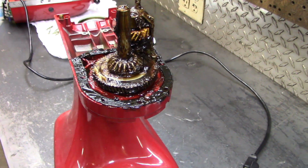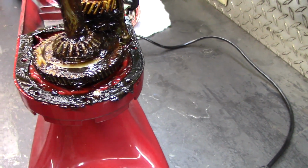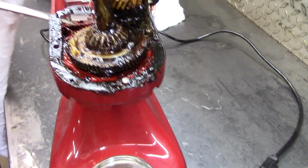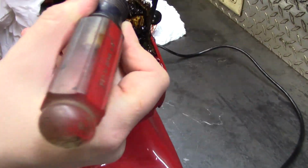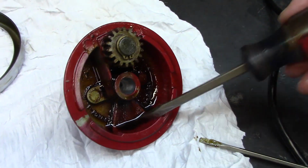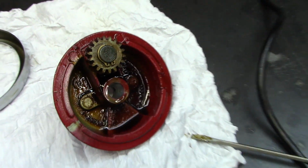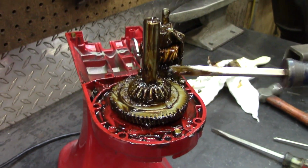So here we are, open, some of the grease cleaned off with the chip brush, and we have this little pin that's holding in the seal. We can lift the seal off very carefully. There's actually tabs in the back, which make that a little easier, so we can clean under it and probably even clean the seal a little. Yuck. This is quite liquid. I mean, that's oil. This is grease that broke down over time, and I believe gone under here, you can find this has more viscosity.